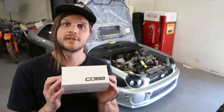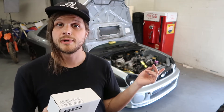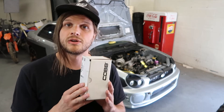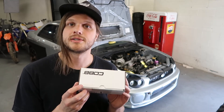Why do you need a 4 bar MAP sensor? Well, you might not. But for our application, we are running higher amounts of boost and manifold pressures, and when you're doing that, if you want to tune accurately, you need to send quicker and more accurate information to your ECU. The way you do that is with a better MAP sensor.